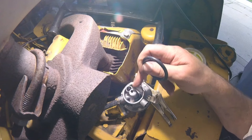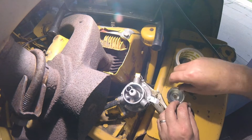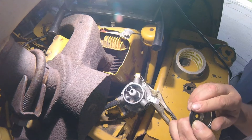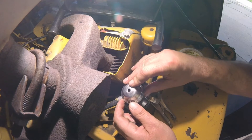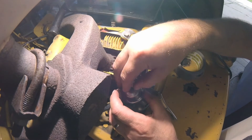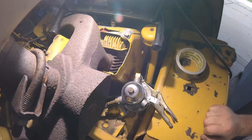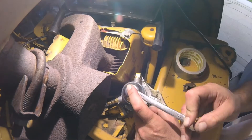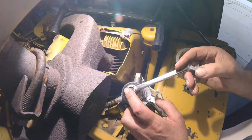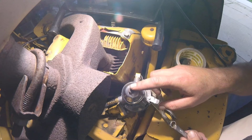Okay, take two on the O-ring. We got our washer, put the O-ring in a little ice bath — seems to fit. I can only get the bolt started. Get in your new home, bitch. All right, I gotta snug that up and we're gonna test her out. That O-ring had a lot of squeeze to her — this thing never actually snugged up. I'm gonna stop there and if this works, I'll take the bolt back out, put some blue Loctite on there, and get it to a torque I'm comfortable with.